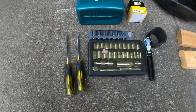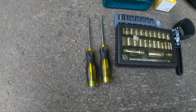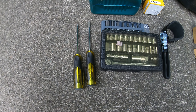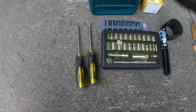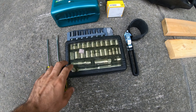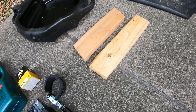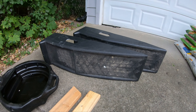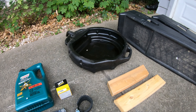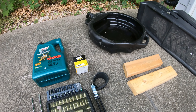Tools you're going to need: I really just need the Phillips, but I grabbed the Phillips plus the straight slot. You'll need that to take off the underbody paneling, which blocks the oil filter and the drain plug. You'll also need a ratchet filter wrench, two chocks for the back tires just to be safe, some ramps to get the car up in the air, and of course a drain pan for the used oil.